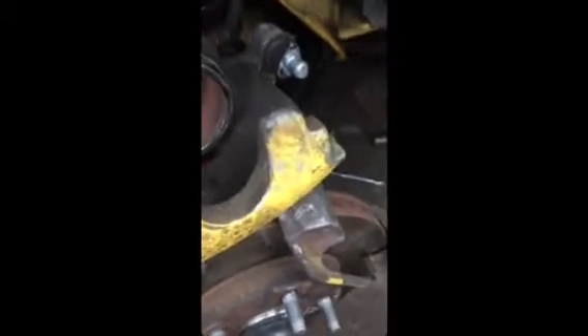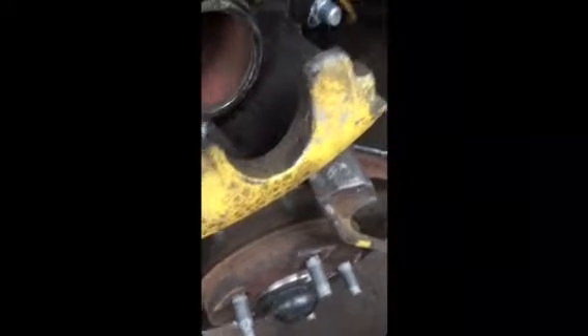While you've got it off, you might as well put some anti-squeak — brake lubricant. You know that squeaking noise when you're rolling down the street? We got something for that. Got it from AutoZone — it stops brake noise on caliper slides and all contact points. We're not going to rub it on the caliper face, but we are going to put it on the back of the brakes. Got lubricant on there — that's on the outside of the brake, not the inside.